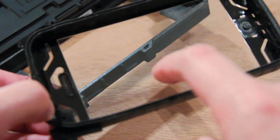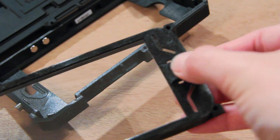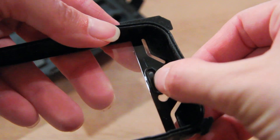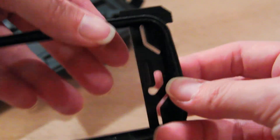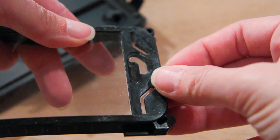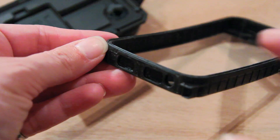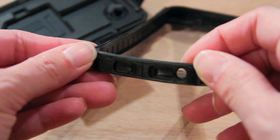So this seal is quite thick in itself. It's still rubbery, you can bend it. This piece also includes the home button which is again the same kind of seal — rubbery, silicone type. It has a clear plastic for your camera and your sensor. And for the speaker, even though it looks like it should be the same type of rubber or silicone, it's not. The speaker here is covered with a very thin layer of plastic. It almost feels like one of those plastic grocery bags.